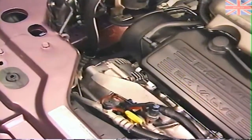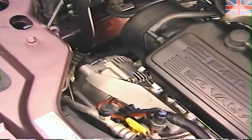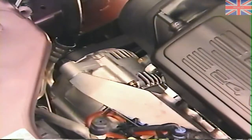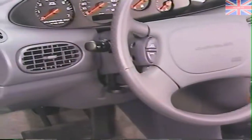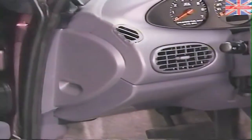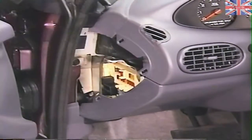If you need to test the charging system, keep in mind that the Sebring Convertible uses a new generator rated at 120 amps. Inside the Sebring, at the left end of the instrument panel, is a junction block which includes the fuse block, accessible by removing a cover on the end of the instrument panel. The body control module is attached to the junction block. As on Cirrus and Stratus, the BCM controls almost all of the body electrical features, including remote keyless entry and vehicle theft alarm.